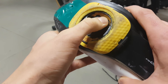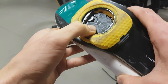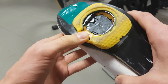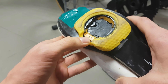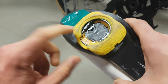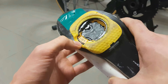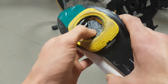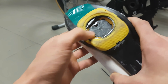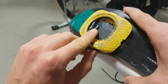This is where the metal interface comes into contact with the plastic. Even though the plastic is quite hard, the case-hardened steel on top of the pedal does dig into it a bit. You can't really notice anything while riding, but if you run your finger over it you can feel it starting to wear. Another piece that is slightly worn is the screw.